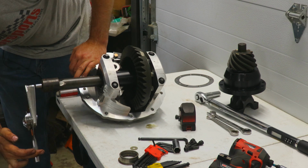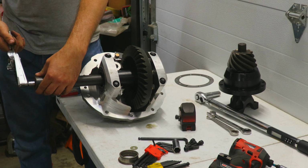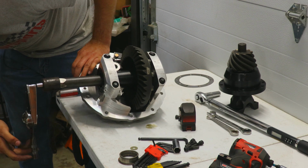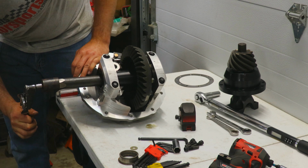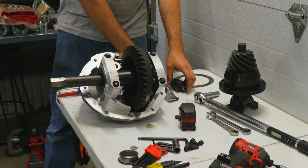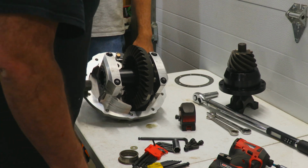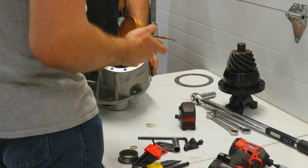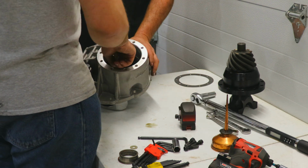Looks like about 12. Yeah. Nice. Good enough? Yep. Okay. So we set this to about 12.5 inch-pounds or pound inches, and it's good either way. So now we can do final assembly of our pinion gear, or hopefully final assembly, assuming it gives us a good pattern. Just a tiny bit, just enough to allow things to move freely.